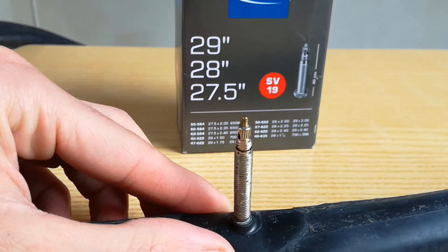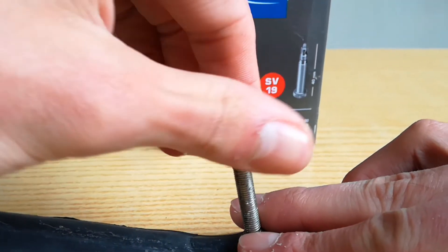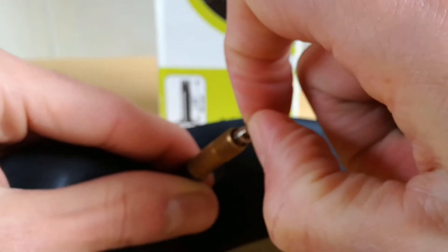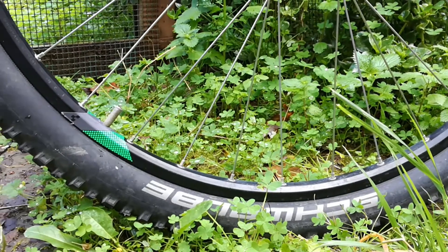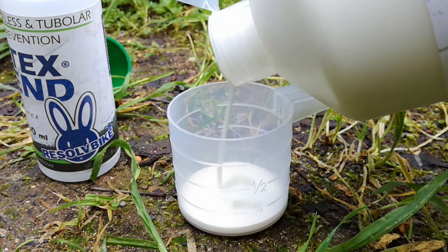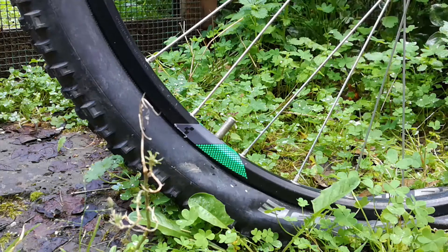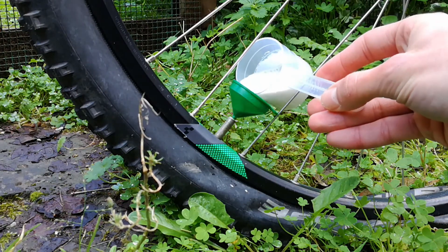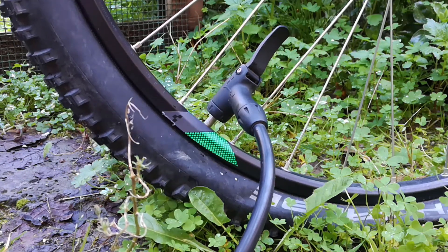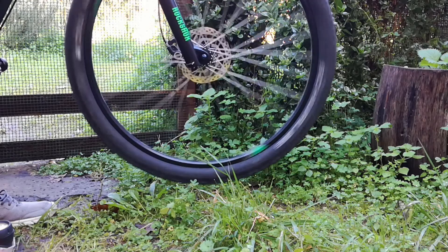How to install. The installation is very easy and the same as a standard tube replacement. Use the core valve tool and remove the valve core by unscrewing it. Then fit the tube inside the rim and tire as usual. Put the open valve at about the 7-8 o'clock position. Take the sealant fluid and put between 15-19 ml inside each tube — larger tubes require more sealant. You can use a small bottle or a funnel. Then screw the core back in until it's firm. Inflate the tube, then let the wheel roll to make the fluid spread all around inside the tube. The first wheel is done — do the same for the other one.